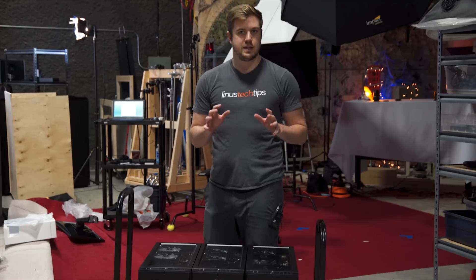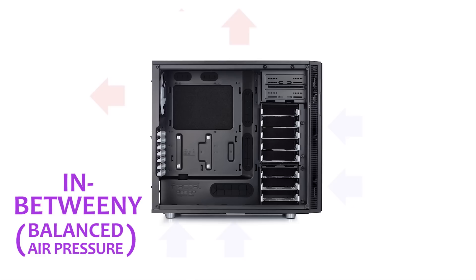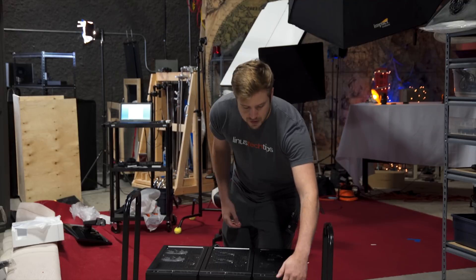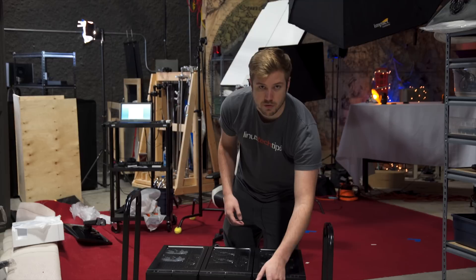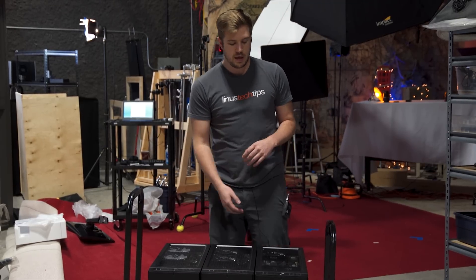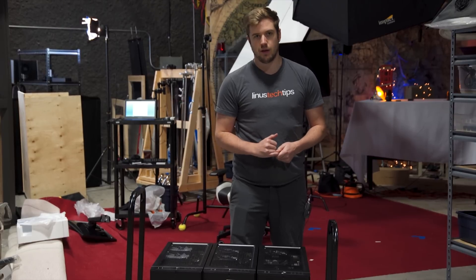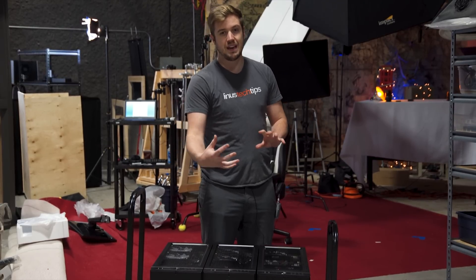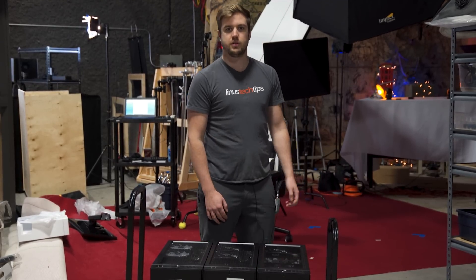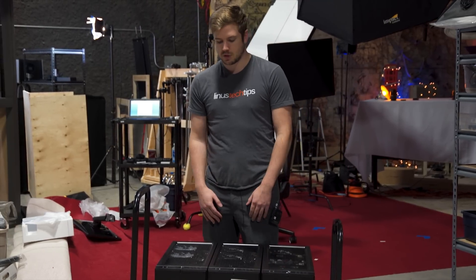Inbetweenie is a little bit different. We have the two in the front blowing in, and two in the bottom blowing in, and then one in the top blowing out and one in the back blowing out. The reason we did this was because the two in the front have to fight with the front panel, which has a lot of restriction — air can only come in through the side and then has to go through a filter. The bottom also has to fight with being against the ground and going through a filter as well. So we wanted to overpower the amount of air coming in because it had to fight against these elements, and the air going out was just fan grills with no filters or obstructions, so we only had two of those fans. A little bit of a different configuration, but should be fine.